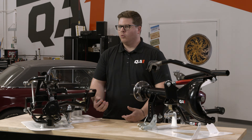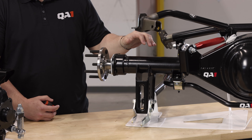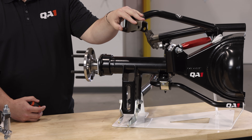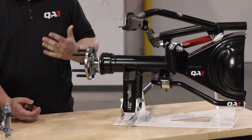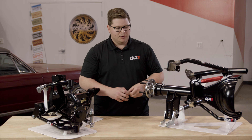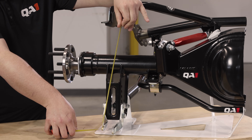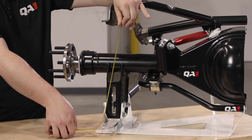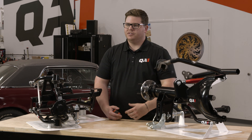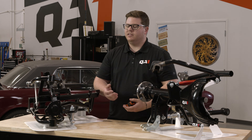I want to show some real-world scenarios of what we would be measuring. First, this is a coilover application on a four-link, which is going to have a bearing mount up top and down on the bottom as well. All we're going to do is get that axle supported to our desired ride height, then draw this tape measure out and take a quick center to center on both of those mounting locations. We come up with a 16-inch center to center at ride height, and we'll use that to find a shock with adequate travel in both directions from that 16-inch measurement.